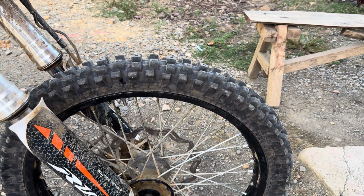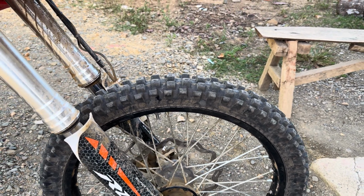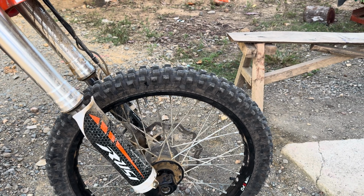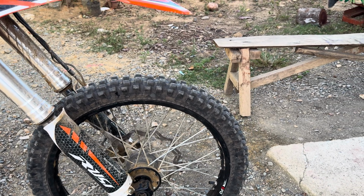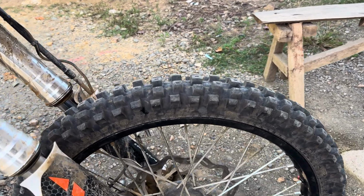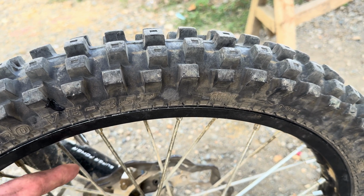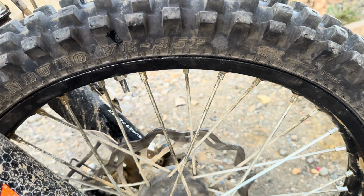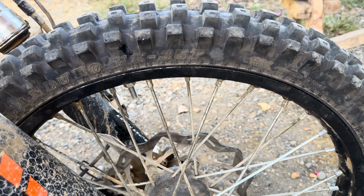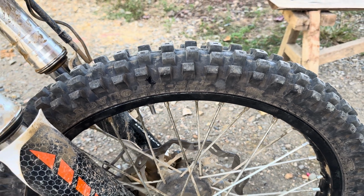They're plastic. I've never used plastic before. It may be junk. I think they're made in China, but they're plastic. They're really lightweight and they're smooth, so we'll see what happens. My 2 cents is just don't over tighten this. Don't get in there and crank it down, because you're talking about metal and plastic together holding your bead in. So don't overly tighten it like you're over torquing the bolts.